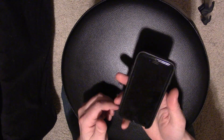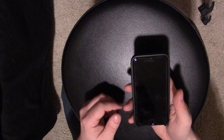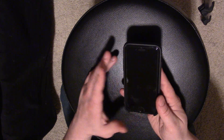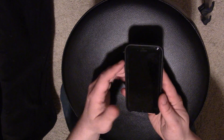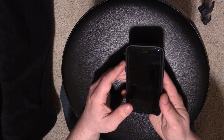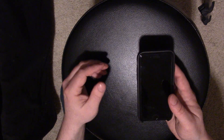That's the unboxing of this case and how easy it is to put on the phone. As just a plain case, I honestly really like this. The reason I got it was because in my house I get like negative 109 to negative 113 dBm readings — that's about one to two bars, which is very poor. I'm very curious to see if it increases even just two or three decibels, because a couple of decibels is a huge increase. But that's more on the second video.